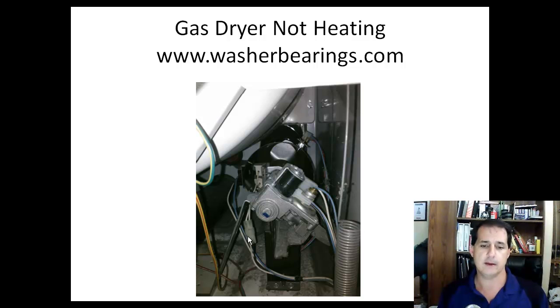Right here is the gas valve assembly. I went over to their house, looked at it, and started the machine up. The igniter started glowing — it's right here, with two wires and a ceramic base. It glowed red, then the gas kicked on and the flame came out. It looked good. However, I waited until it cycled a few times where it reaches temperature, the thermostat shuts off, and then it's called to come back on again. The igniter would come on and I'd get a little faint click. I brought an igniter with me just in case, because those are the common things that fail.